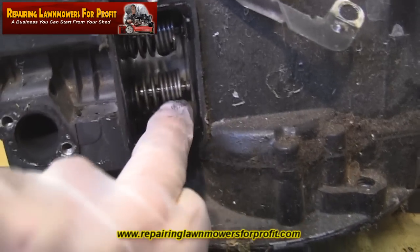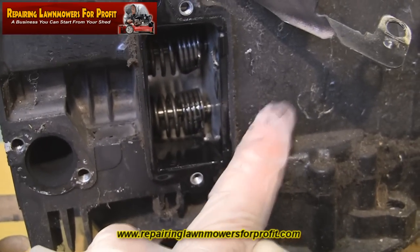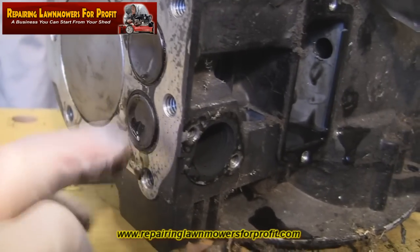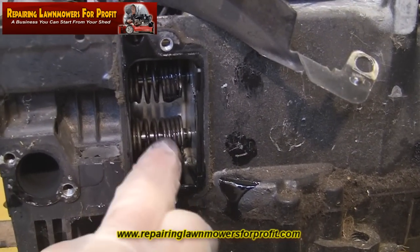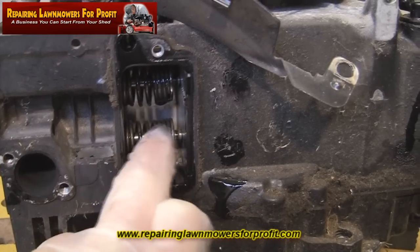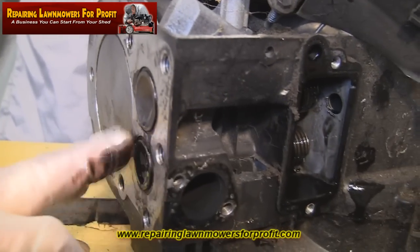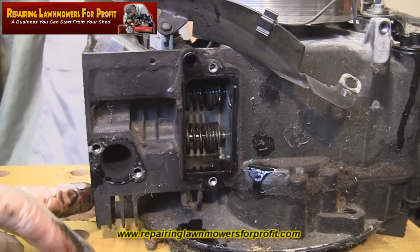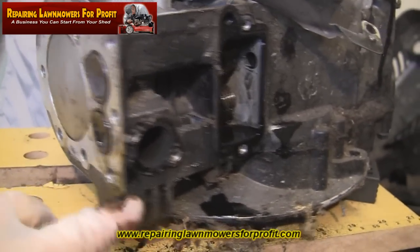Once you've found top dead center on the compression stroke, you'll be able to set these valve clearances in here. There's no real adjusting mechanism because inside it's basically on a cam. Once you've ground the valves down it might just be worth checking the clearances on both valves. To do this you would use a valve spring compressor — compress these springs, pull them out, get your valves out, grind them down with a little bit of paste, grind them around the edges, pop them back in, and check the clearances. So if anyone wants to know where the valves are on this Briggs 35 classic engine, that's where you'll find them — take those springs out, grind them down, and you can set your clearances.